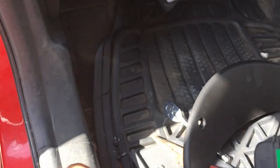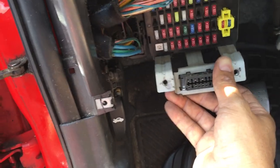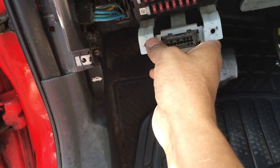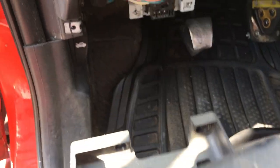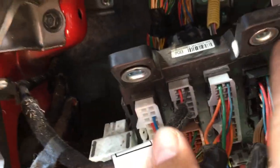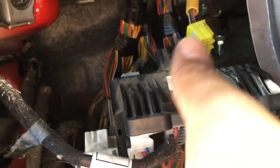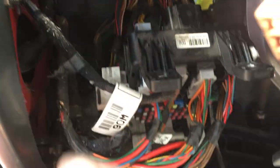I have to take the whole fuse assembly right here. There are two bolts right here — you take them off before you take the metal assembly. Those two holes right there hold the bottom part of the fuse block. I also have to take the top fuse block part, which is mounted right here. In order to pull it down, I have to disconnect this yellow connection right here and get into the flasher right on top of the fuse block. No easy task for sure.